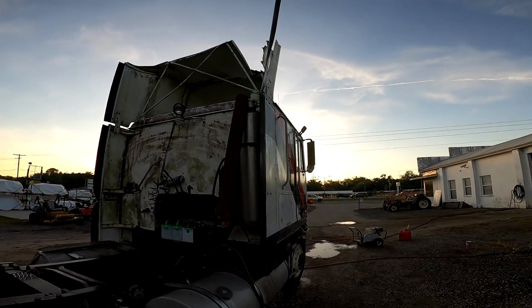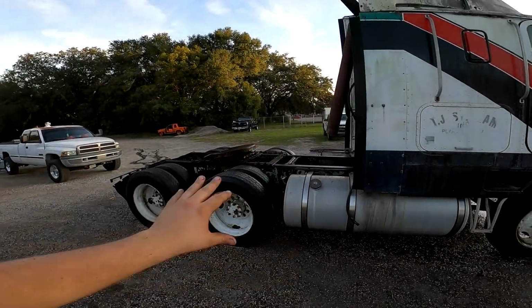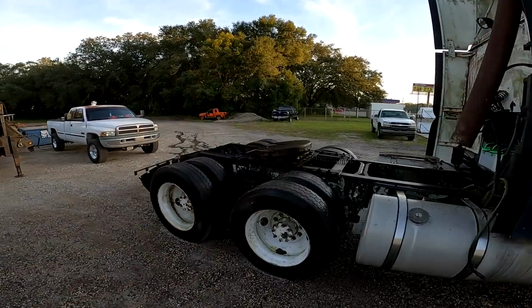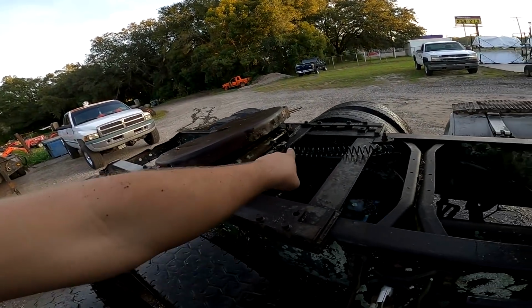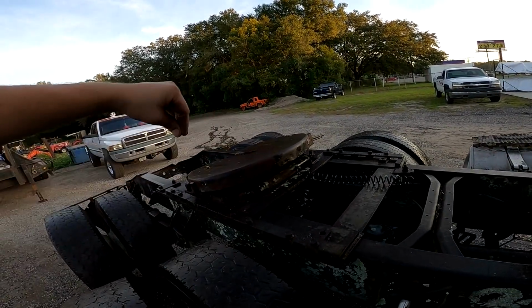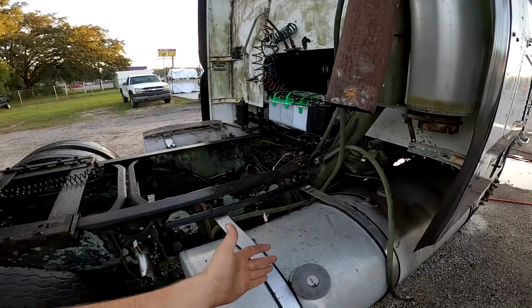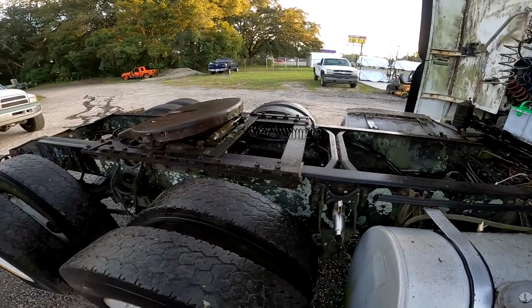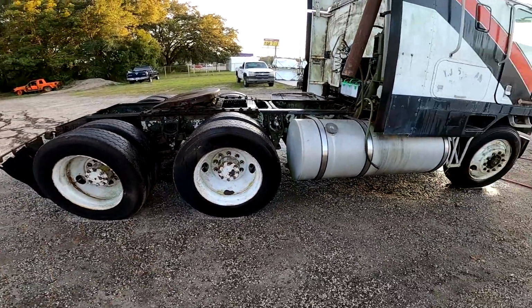The next video you guys will be watching will be us unbolting the top up there, pressure washing the back, and trying to get the fifth wheel freed up. It's been sitting for a while. It's got an automatic slider there, so hopefully the chrome on that cylinder isn't torn up too bad. What that does is basically unlock the fifth wheel so you can slide it front to back depending on what kind of load you've got. We're gonna be getting all of the limbs and stuff cleaned out of here, and I've already got a hookup on some used 24.5 wheels to go on it, so that's exciting.